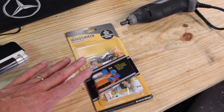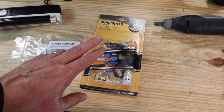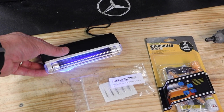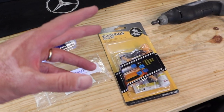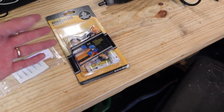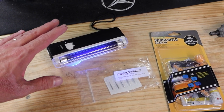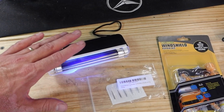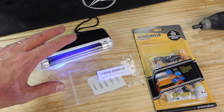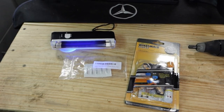What the UV curing light is going to do is allow me to cure the resin. The resin this product uses dries using UV rays or sunlight. A lot of times I end up with these cracks during winter when there isn't much sun, it's raining, or the car's in the garage — you really can't use these kits then. This UV light lets me do the repair in my garage without pulling the car into the sun. This is what your professional windshield repair guy uses — UV light to cure the resin so it's locked into the crack and won't run out before it dries.